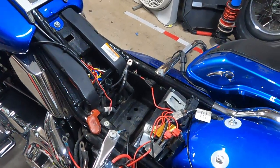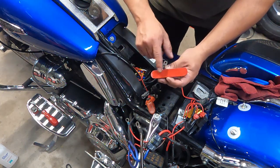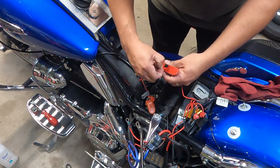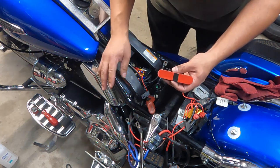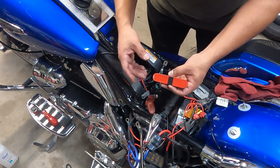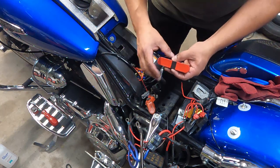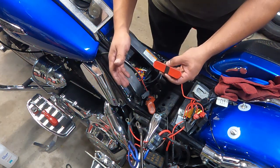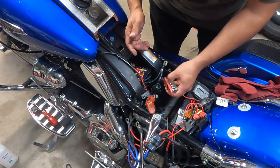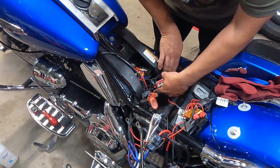Maybe you're wondering — how do I dry-fit this if I'm using 3M red tape? What I do is put the tape on the back side, then cut a small portion with an exacto blade to only expose a small piece of the backing. That's enough to hold it in place temporarily so I can put the battery in and check clearance. If it doesn't fit, I only have to fight that little strip to remove it instead of the whole thing. Once confirmed, I pull it off, remove the remaining tape, and put it back properly. If the dry-fit section gets dirty, no big deal — I've got two huge patches holding it in.